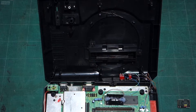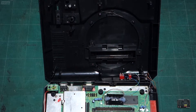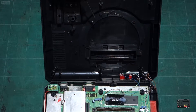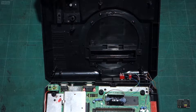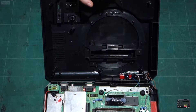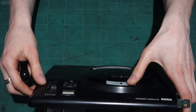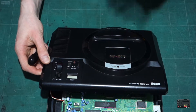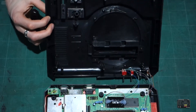Okay guys, this is where our LED is currently sitting. Because of the difference in the plastic on this machine, there's no really clean way to get this current LED out of this bit of plastic. So unfortunately I'm going to have to drill into this plastic. Some tops will have a tab area which allows you to pull out the plastic bit and whip the LED straight out of the front, but this one unfortunately is more of a sealed unit.